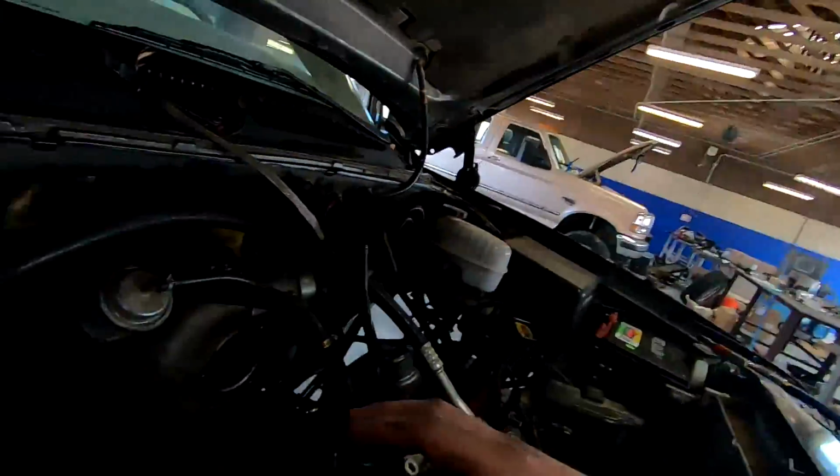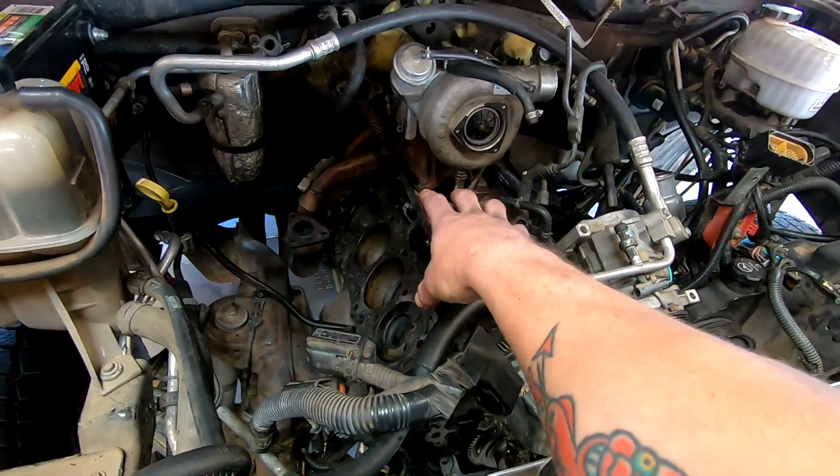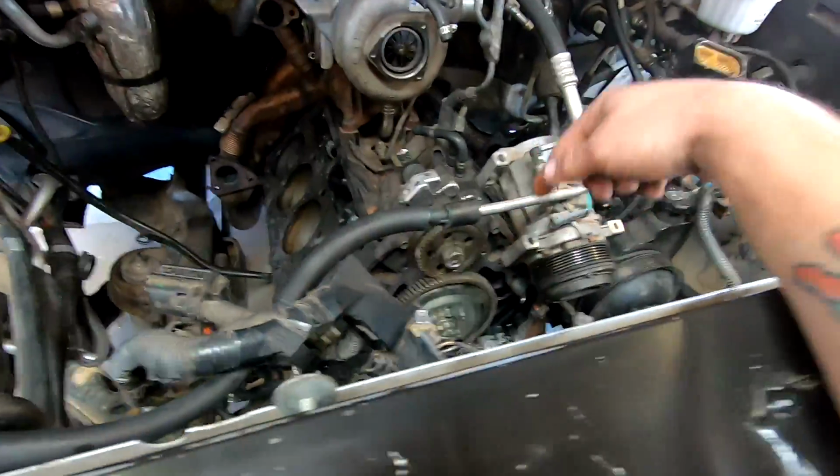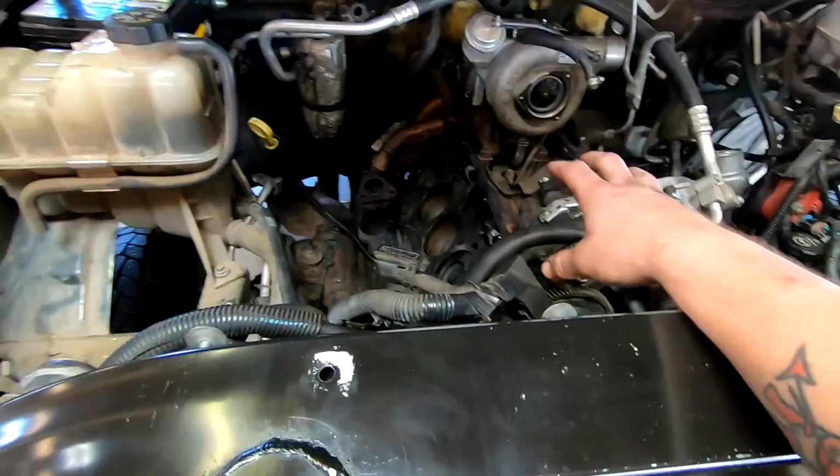But I'm gonna throw the gasket on now. I don't have an angle torque gauge to torque the bolts, so we're gonna get the head set on, probably throw the bolts in, get the push rods in with some assembly lube, and then just leave it like that for now. That way at least it's covered, this side's clean, ready to go. But I need to pick up an angle torque gauge this week. That way we can actually torque the head bolts and check timing to make sure all the gears are on correctly and everything. So probably gonna get that head set on.